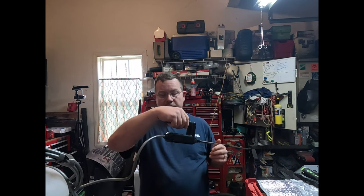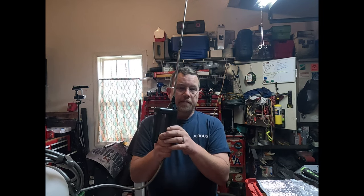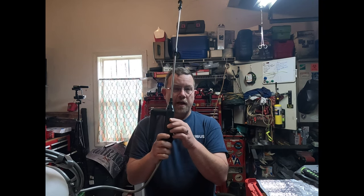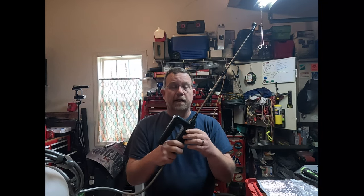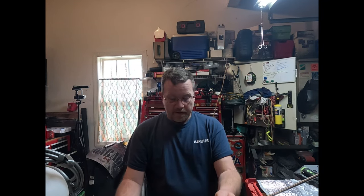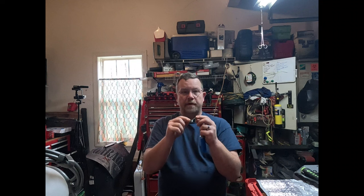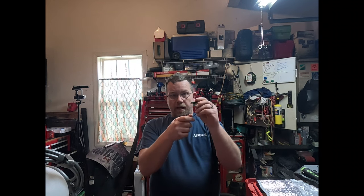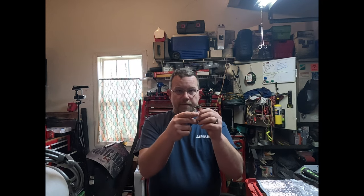With the pipe tape on, as you'll see in the video, it ran and I have no more leaks — I can leave it around all over the place with no issue. A lot of people were upset about these on Amazon because they were leaking or stopped working. The reason why it stopped working was, like I said, green crusties all over the circuit board, so I took regular electric cleaner, cleaned it up, scrubbed it a bit, and it works.